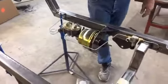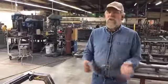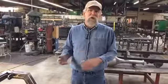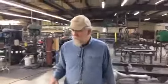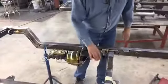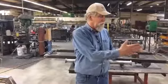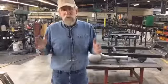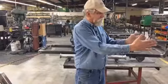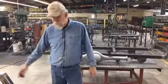Brakes, bottom line, the fundamentals of hydraulics, pretty simple. There's no give in that oil, just like there's no give in water, whereas if I got air, I can compress air. And that's why when you bleed your brakes, you need to have all the air out, because what will happen is your master cylinder tries to push that fluid to the brake into the wheel cylinder and push that pad out. If there's air in it, it'll compress that air before the pads on your brakes compress against your rotor or your caliper or whatever, or against your drum in the back.